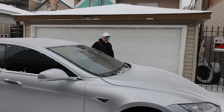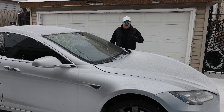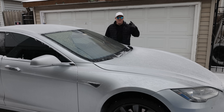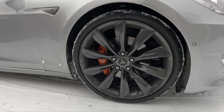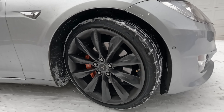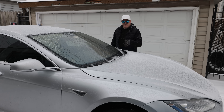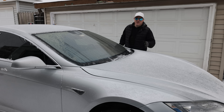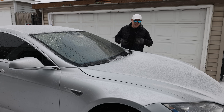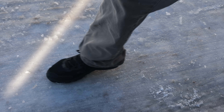That was really interesting — I learned more in just that run than all of the others combined. Because it's electric, I could actually hear the brakes working better since there's no engine sound. I had way too much faith in the Tesla to stop — I don't know if it's the weight, but this car just kept going. The ABS was working overtime. The second interesting thing is I still had steering capability even while jamming on the brakes. That's where ABS is beneficial: during the pulse interval when the wheel isn't locked, it rolls and you can steer. I also realized why I thought it was pulsing faster — because all four wheels pulse and if you multiply one wheel's pulses by four it sounds much faster than it actually is. Now that we have quite a bit of snow, we're going to throw down some water, make a nice sheet of ice, and do all three cars one more time.